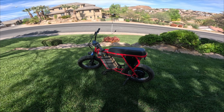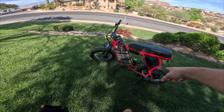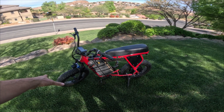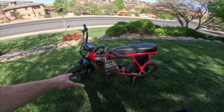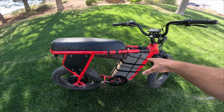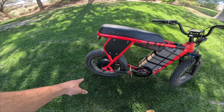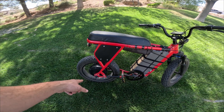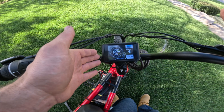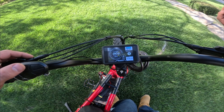It is not stock at all. The specs on this bike: these are 20-inch tires, it does not have any rear suspension, and we have motorcycle tires — these are Shinko 244 tires. We have four piston brakes front and rear, and we have an 80-amp BMS on the battery which can burst up to 200 amps. The motor is rated for 5,000 watts and the controller is rated for 100 amps. For the display, we are using a UKC1 display and it has five power assist modes.